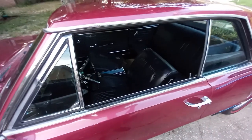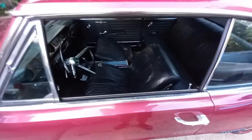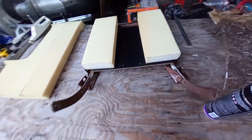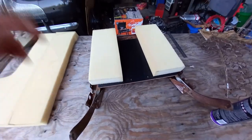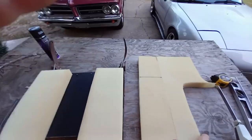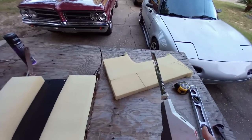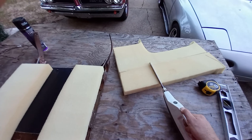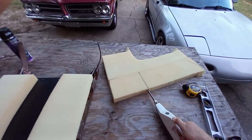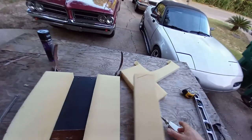For now I'm driving with just one seat — I took the back off the passenger seat, put it on the driver's seat, which is ten times more comfortable. This is just a simple piece of fiberboard screwed in from the back. It's going to be under about six inches of foam, so it won't really matter. This is super dense foam, and then I have some thinner memory foam that's going to go on top, and then a polyester batting. If you ever plan on doing interior work with foam and you don't know the secret of an electric kitchen knife for cutting foam, you need to take a lesson — cuts through it like butter.